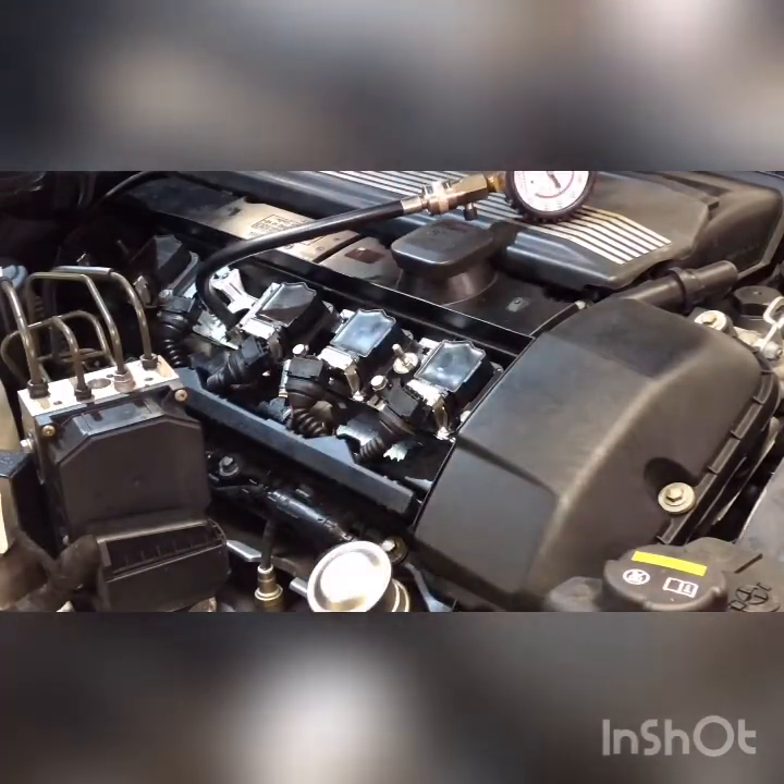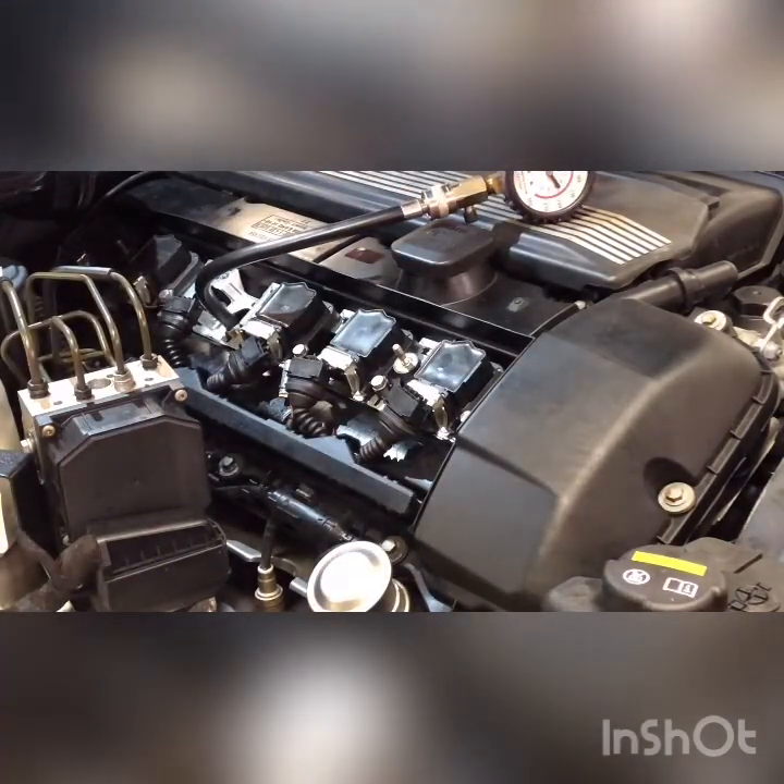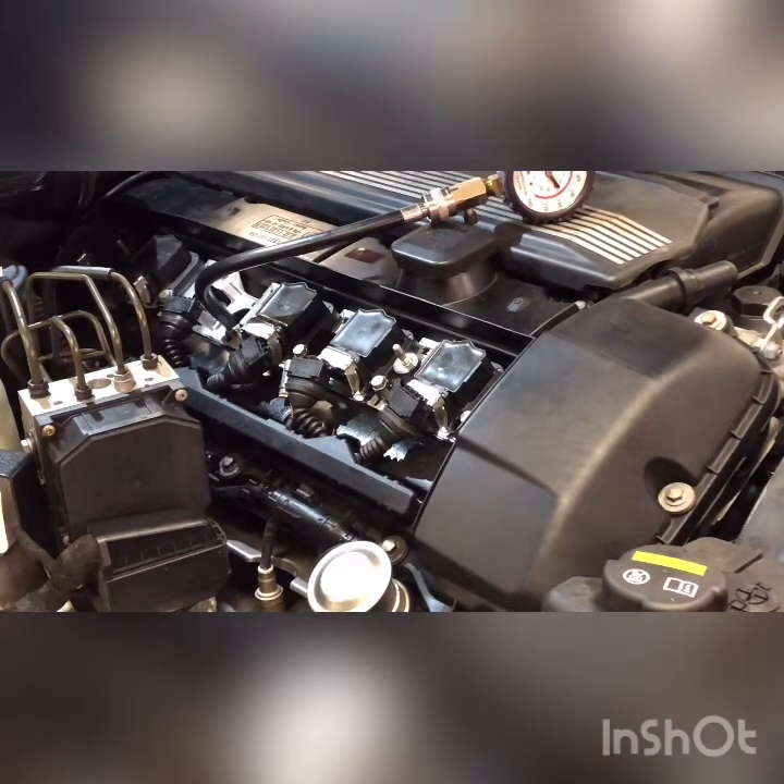After that I did the well-known trick where you dump fuel system cleaner into the cylinder and let it sit, trying to break up carbon buildup, then blow it back out. I let that sit overnight — no effect. I also ran some through the engine via the gas tank, still no effect.